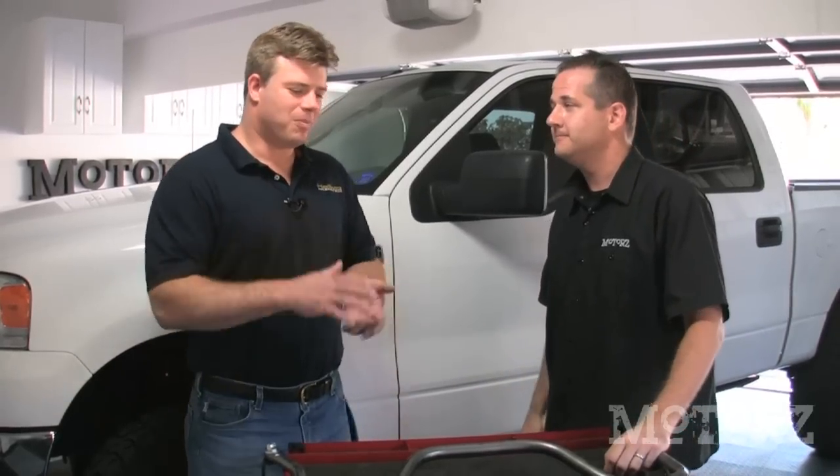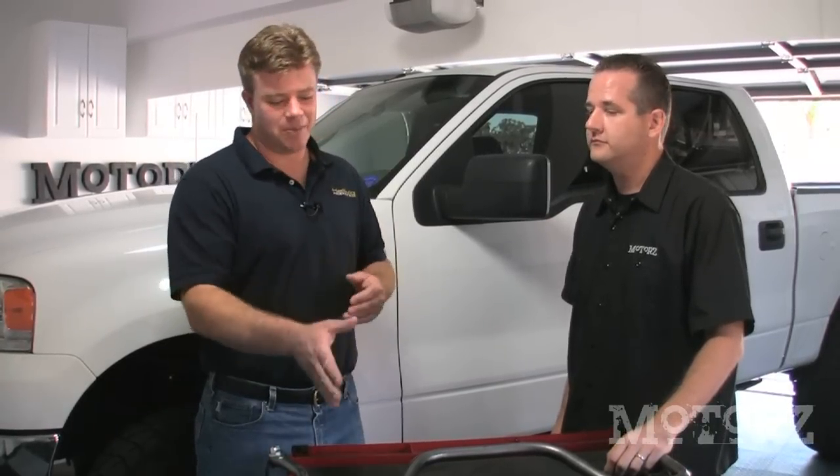So David, we've got our project vehicle here — a Ford F-150, lifted six inches and on 35s. Once we put the front and rear sway bars on, what kind of differences can we expect? The front bar is an eighth of an inch upsize over stock, at one and seven-sixteenths inches — about a 30% improvement in roll stiffness. The rear bar is a one-inch diameter bar, which is a 100% improvement over what's on there, which is nothing.